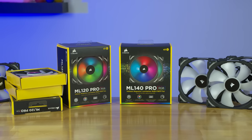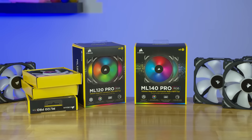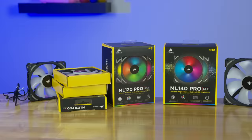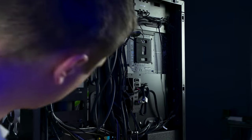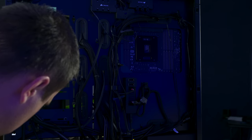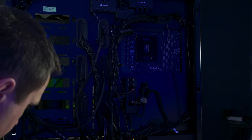I can say this right off the bat, when you are wiring this many RGB fans from Corsair, it is a pain in the butt. I mean, just flat out 100% pain in the rear. I bought 2 3-packs, so they came with their own little miniature nodes, and those are the controllers that control the different RGB settings for each fan, and you have to hook them up in sequence. And then I ended up having one fan that went out, so it made the other ones past that one not work. It's just a big headache, not only for wiring, but to get them to work in general.